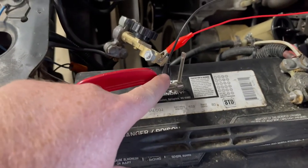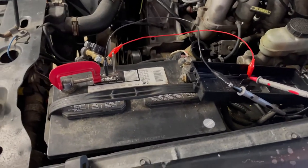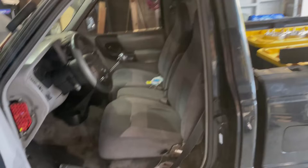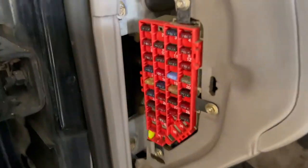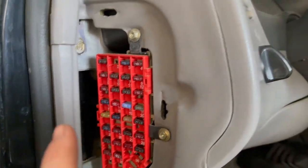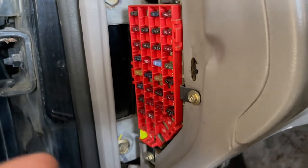This is measuring the amperage going through the circuit. You don't want to start the car or turn anything on because most likely your multimeter can't handle that much amperage. Currently it's something like 240 milliamps, which is a pretty significant number. What I'm going to do is go to the fuse panel and pull each fuse one at a time — a bit of a tedious process — until I see it go to zero. Once I find that, I can go back to the owner's manual or the internal reference diagrams inside the vehicle and find out which system is causing this parasitic drain.